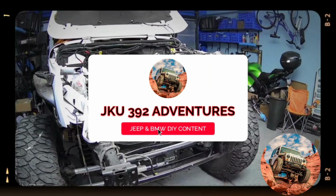I did take out this cross member and I did weld on the B plate that's from Jeep Speed Shop. I'll also go over the routing of the 392 JL cooler lines for the transmission. Those work really nice. Only had to make slight modifications to the exhaust.